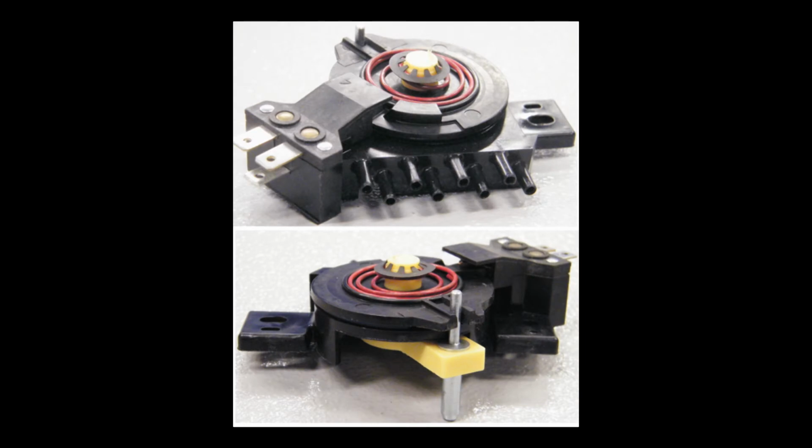Another possibility could be the control switch itself. If you have the control selector set to air conditioning, for example, and the vacuum motor down on the heater, air conditioning chamber, plenum chamber is not getting vacuum, and the switch itself is getting vacuum supply to it, then you possibly have a bad switch. Plenum chamber is the term that Ford used for their entire heater and air conditioning case that goes in under your dash.